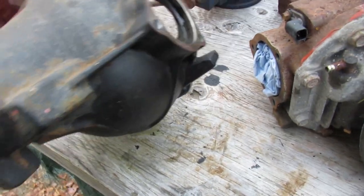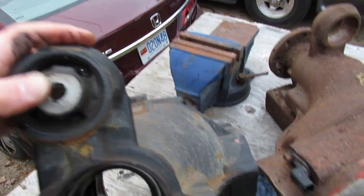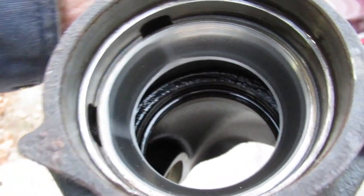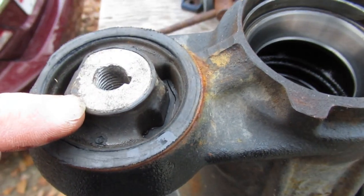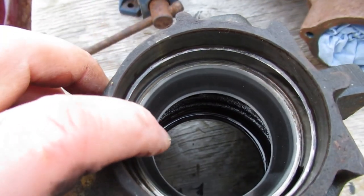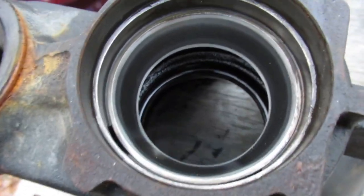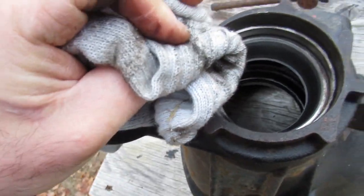This one died on me - it was really noisy after I changed this bushing. In fact, whatever I did when I changed this bushing essentially destroyed the differential. When I changed the bushings, I just disconnected the mounts, spun it, flipped it upside down, and hung it down to work on it. I think I let garbage fall into the bearing when I did that. It's not totally chewed up or anything though.